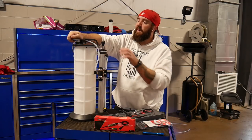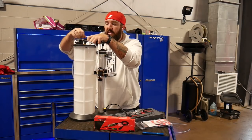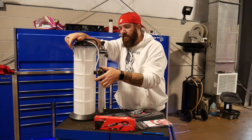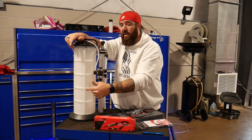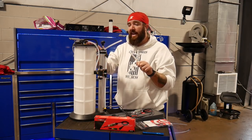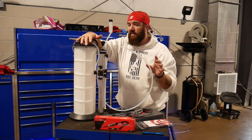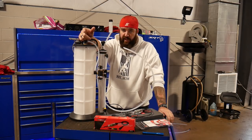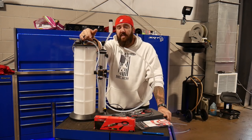Once you get it all sucked out, you can read how much you took out from the graduated marks. There's a plug in the very end that you take out to drain the fluid and reseal it, giving you a nice tight vacuum. Then if you want to refill, you put exactly how much you took out back in with brand new fluid, seal it back up, switch over to pressure, put the hose back in, and pump it about five or six times — it adds pressure and pushes all the fluid back in without constant pumping. I'll put the link in the description. I think this was right around $200 — a nice time-saving tool, especially for rear diffs, transfer cases, or that rare occasion where you can't get a pan off but can still offer the customer a fluid change.